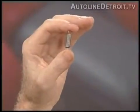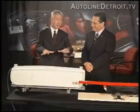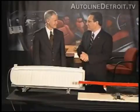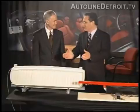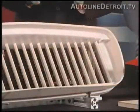And a whole lot less mass. Lower cost, lower weight, very little energy consumption. And in particular, we can package things we couldn't fit a motor into. We're going to show you what some of these smart materials can do. You know all the emphasis we have on fuel economy today. In the end, I have to move the vehicle, and its fuel economy depends on weight, rolling resistance, and aerodynamics. So one of the things we'd like to do is control aerodynamics dynamically — open and close louvers in front of the radiator. Doing that with smart materials: just watch the grill open and close dynamically.